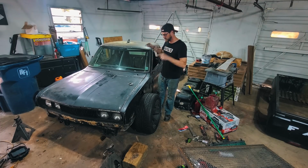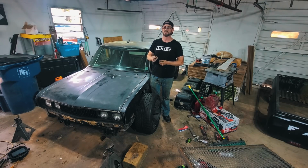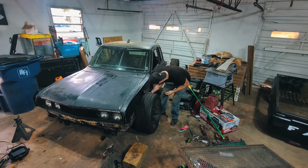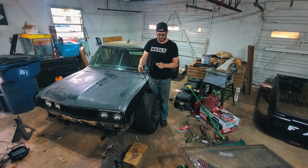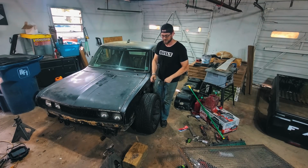So now that we have it on the ground, we need to be able to pick it back up to do the brakes. We haven't picked a permanent solution for our control manifold and everything that's going to go into this airbag system. So for now, I just grabbed these. They're just little Schrader valves. They're the first cheap thing I saw online to buy. They just push fit onto these little 3/8 tubes. I might be able to pull one out. Oh. They'll just push fit on, and I'll be able to put air in and lift the truck and lower it. So let's fit these up and see how they work.